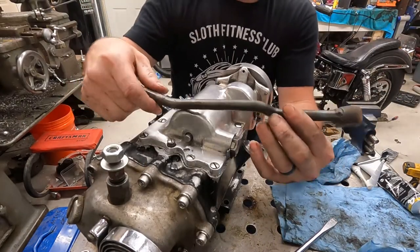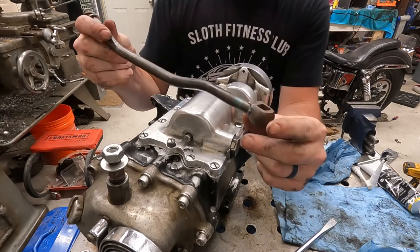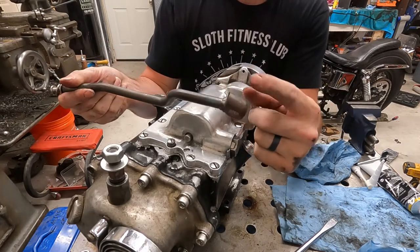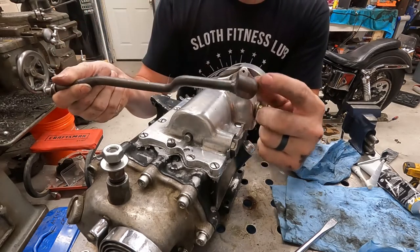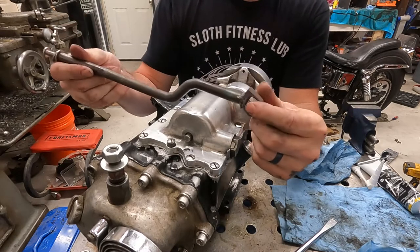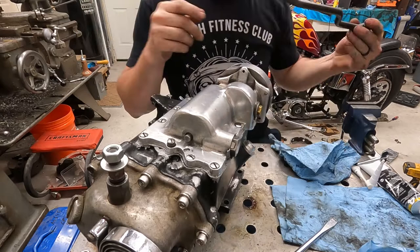So this here is that clutch rod that we had made from that fork that goes inside here and it fits on here. But as you've seen, we have not shaped this yet. So I welded it and stuck it on there, mainly to make sure there's nothing else that needs to be done to it, but we still need to shape this thing, because it's still from when I cut this off. Again, this is a hardened piece, so this will be fun to shape. But once we have that done, this part will be done. All right, I probably should paint this, but I think we're just gonna leave it raw.